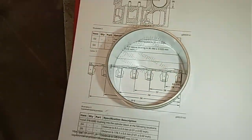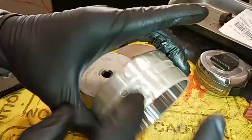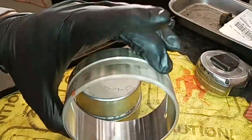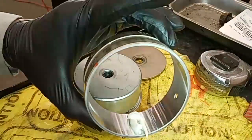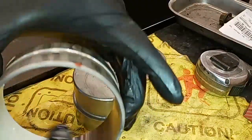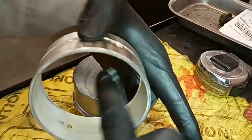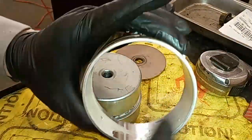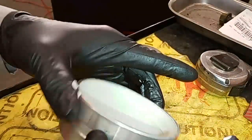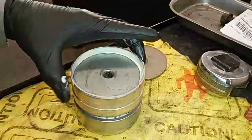Let's get ready to install this bearing. This is the same tool we use to extract the bearings — it's a guide tool on one side and a bearing retainer on the other. I like to put a little dot of paint with a torque stripe paint marker where the joints are. It really helps you see where the joint is because it's going to be hard to tell once the bearing is on there — it'll be surprisingly easy to miss it. What I'm applying here is white lithium assembly grease, the same stuff I typically use on crankshaft bearings. You could use engine oil, but the grease is a little thicker so it's less likely to run off. Remember, you cannot compress a liquid, so it's good to put a liquid or thick grease between the bearing and the driver — that way anything between the two typically will not damage the face of the bearing itself.